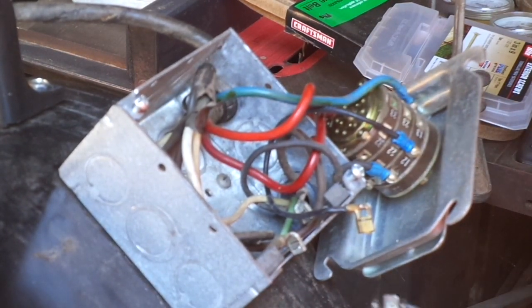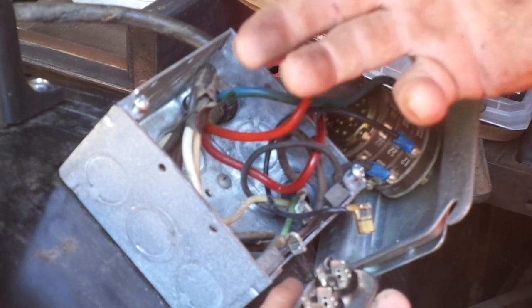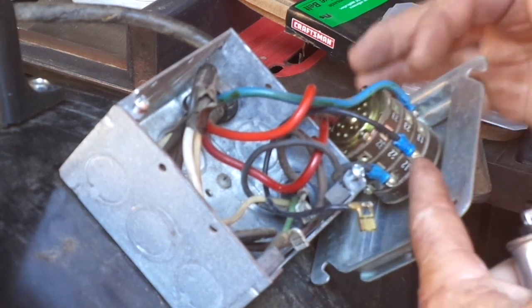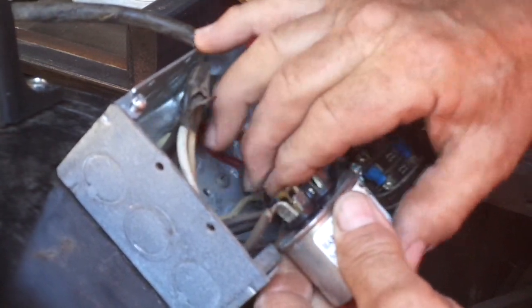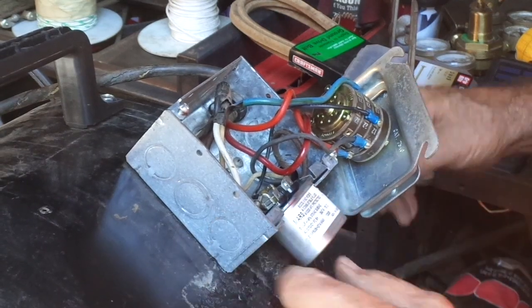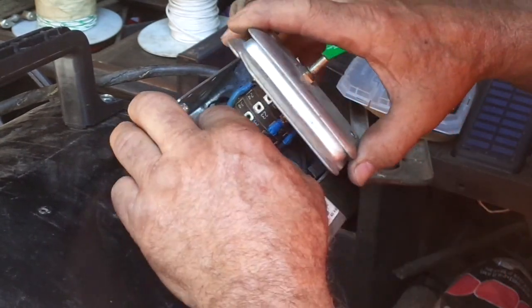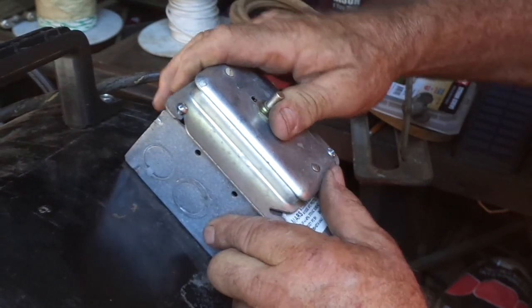This is a PSC motor — a permanent split capacitor motor. Typically your motor is going to be wired one of two ways: either two individual brown wires designed specifically to go across the capacitor, or the capacitor has to be fed hot from one side of the line — in this case 110 volt line voltage. So this is our line voltage coming in off of our rotary switch. I'm going to put this one here onto the terminal that feeds the single brown wire off of that motor, then take the other brown wire and slide it right into the bracket. Got that thing fit in there — it was just a little odd the way it mounted.